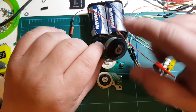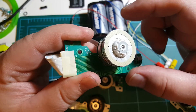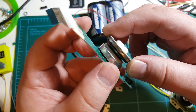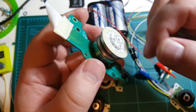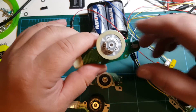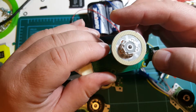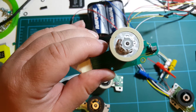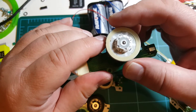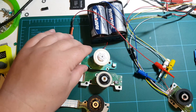An interesting thing I noticed: some of these motors just spin and that's it. But this one, if you listen carefully, it makes a noise — and it's not accidental, it's not that the motor is worn out. There's a metal case here, and I think inside there are bearings. If you spin it, these bearings move around, and some drives make this funky sound when you spin them up or slow them down. I think their purpose is to stabilize the spindle — so even if it's not perfectly balanced, they find their spot and cause the spindle to become balanced. That's just my theory.